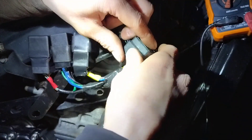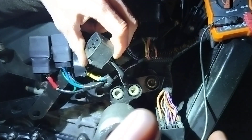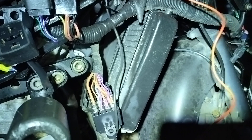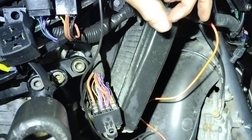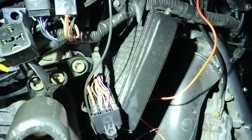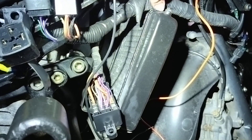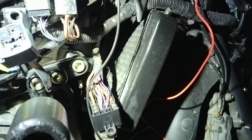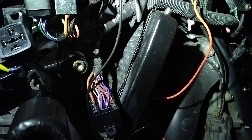Here's a quick idea on how to fit a manual cooling fan switch for the Triumph Sprint ST 1050, and for most other bikes. It uses a thermostat switch that senses enough heat to complete the circuit and allow the fan to come on. The reason a lot of people put a manual fan switch on is obviously for hot days, riding through town, slow-moving traffic, filtering, or off-road — the bike can get hot quickly and sometimes the switch doesn't bring the fan on soon enough.